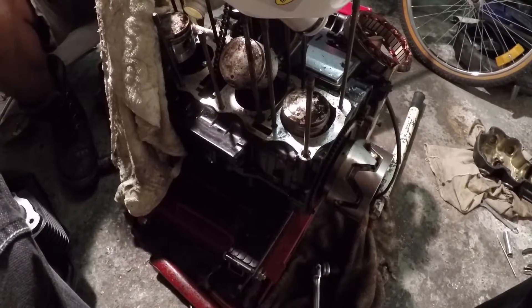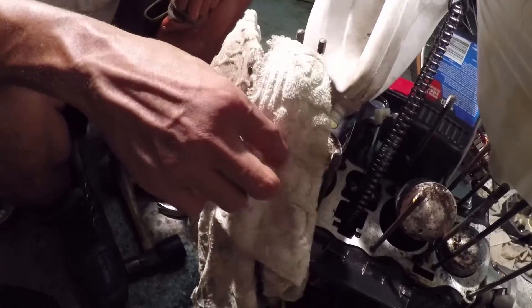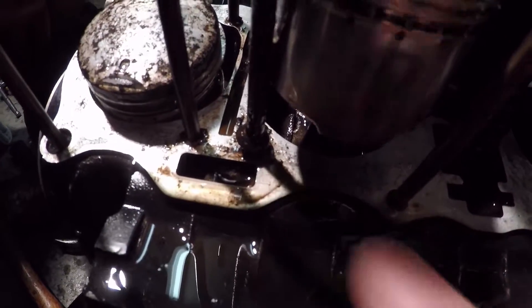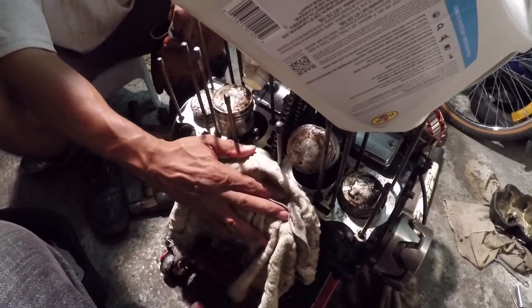I think the resistance was more in there than in the pistons. If you look at this side, there's like a texture on the rod here that was created by the crud going into it, and it kept us from pulling — especially the brake lever side of the jugs up on this side. It was pretty bad in this area here; you can see all the crust and the disgustingness. Now we have all these jugs pouring oil into the crankcase, and some on the floor — that's why the rag was there, to keep it from hitting the floor.